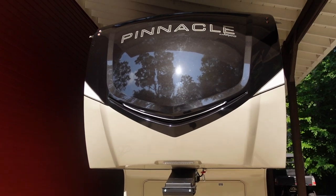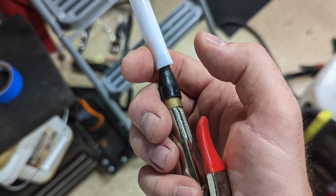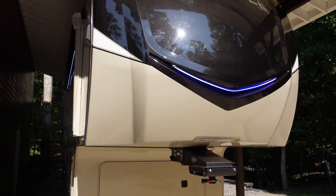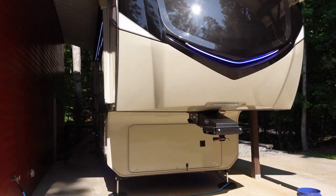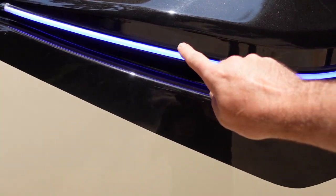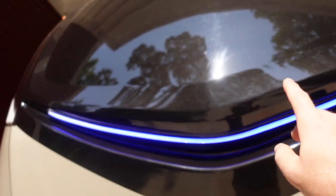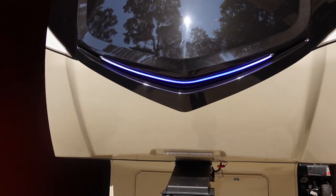Once completely clean, make sure it's nice and dry inside. I took a simple air blower nozzle connected to a compressor and blew out the inside of the tube. You could probably also just let it sit out for a couple of hours to evaporate. Now comes the fun part — stuffing the new replacement LED strip inside the existing vinyl tube. I'll put a link in the description to the replacement LED strip I used. It's a high-density LED strip, sometimes referred to as a COB strip. The individual diodes are closer together, which is what makes it appear like a neon tube light when finished. If you use a regular LED strip, you're going to see the individual LED lights and it won't look like a neon tube, so make sure to get one labeled as high-density.